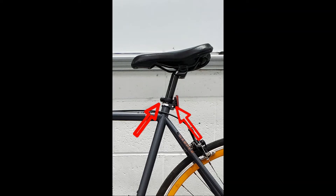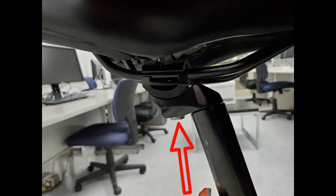When you get the right height, use the electrical tape to wrap around the bottom of your seat post right above the part where it goes into the frame. Once you find the proper seat height, you're going to move on to find the best saddle position. Your saddle should be parallel to the floor — if it is tilted up or down, it could cause discomfort when riding.